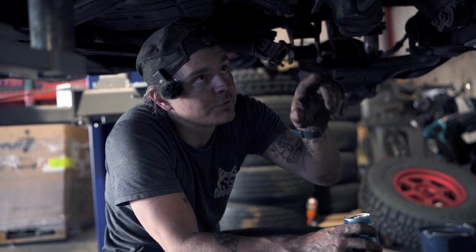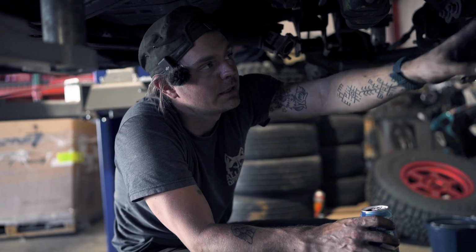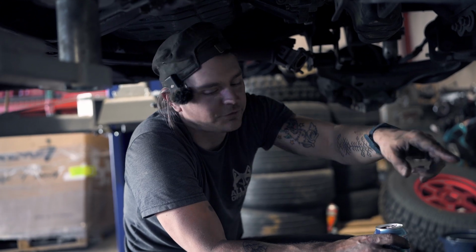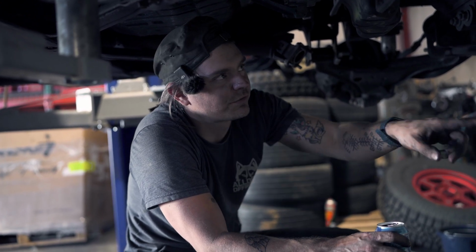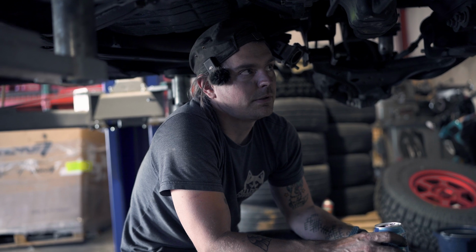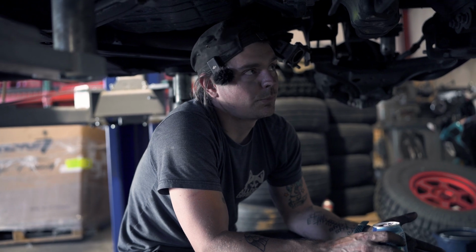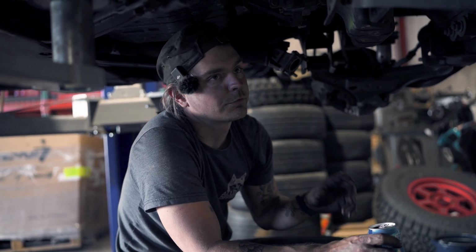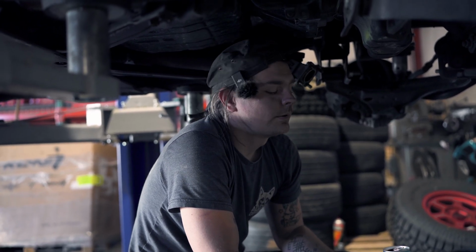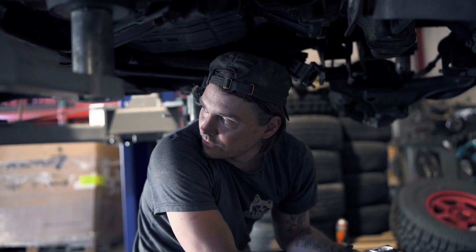We use our ADO cam bolts on this truck, and the forward one we had installed such that the longer part of the bolt was pointing back. It kind of made extracting the bolt outward away from the engine difficult, so we just took the cutting wheel and lopped the bolt off, because if it ever comes out, it'll probably be cut out because it's seized up or something. I don't see a reason why we'd pull the whole control arm, and if we do, we could always just put a new bolt in. It's pretty easy to do.